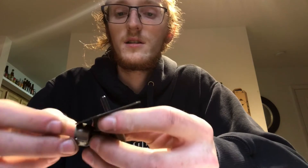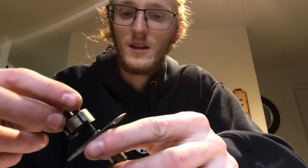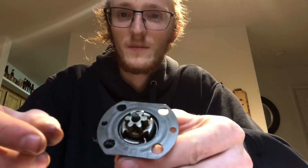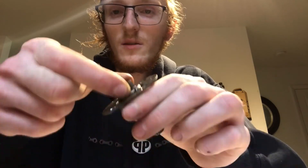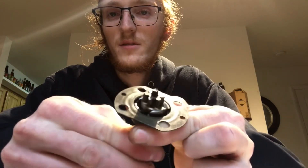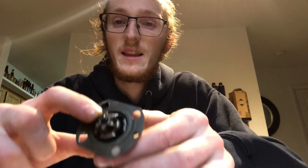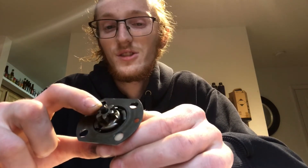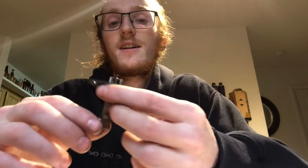There's a little spring — you drop that right down on there. Then that slides in. When you turn the gear it's stuck, it will not budge. You turn the handle part and it spins. I think basically the spring is trying to expand when you turn on the gear, and that freezes the spring up in place. So when you get a push on your window or hit a bump, it's not budging — unlike my current setup.